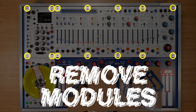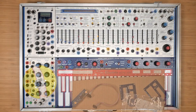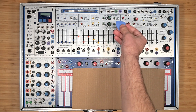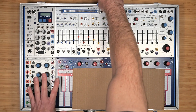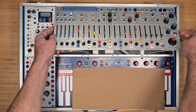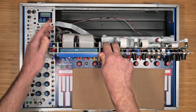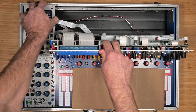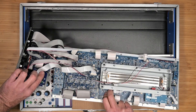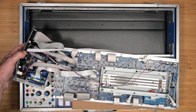Remove all the black front panel screws from the perimeter of the 208C and the MBO. We'll then remove the lit box from the MBO to make room for the program manager. In order to install the program manager, you'll need access to the backs of both the 208C and the MBO. Get a stiff piece of plastic like a spudger or even a credit card to first work your way under the 208C — you'll want to do the 208C first to give you easier access to the MBO. Tilt the 208C forward, then bring it up and rest it on the metal rail. You'll now be able to get the MBO and lift it straight up, then tilt it forward. Now you'll be able to tilt both pieces forward and rest them on the easel. You'll now have access to the screws on the back of the lit box and the screws in the back of the 208C to properly install the program manager.